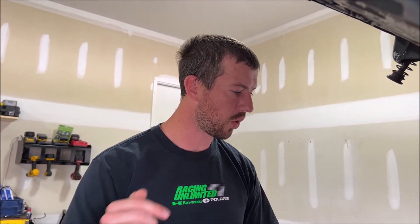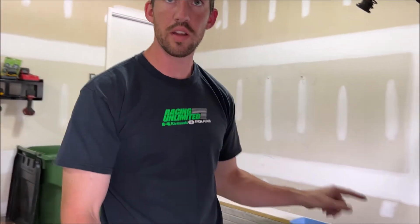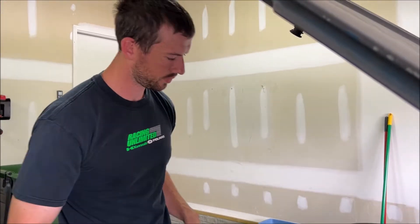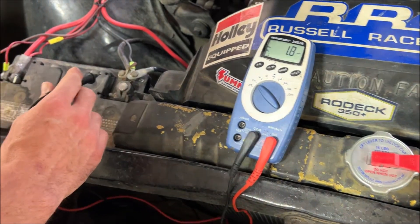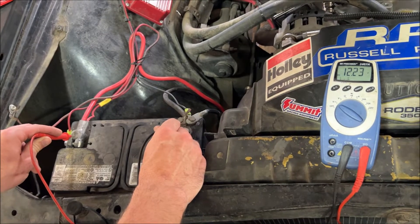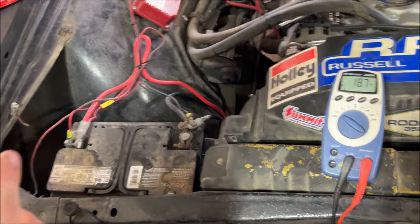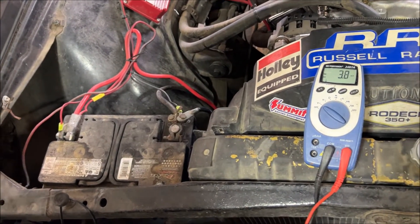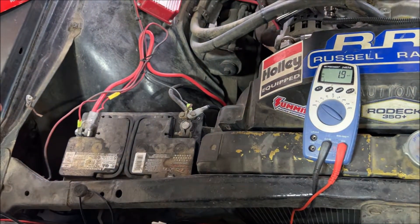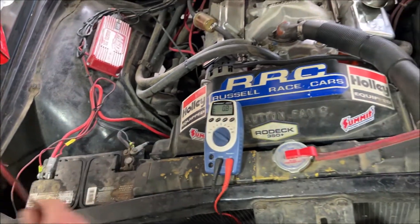Next I'm going to go over to my alternator while it's running. I'm going to check my voltage before I start the vehicle, then start the vehicle and check the voltage again. So I've just gone over to the terminals on the battery. Beforehand, at the battery, it looks like I have 12.2 volts — so we know that the battery is good. Now we're going to start the engine and check the voltages after we start it, then check if we're actually getting the signal from the alternator coming out to the voltage regulator.